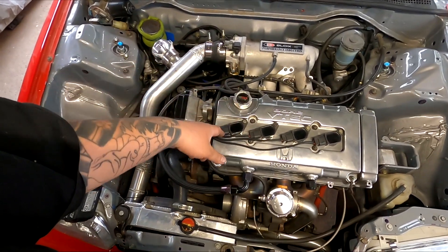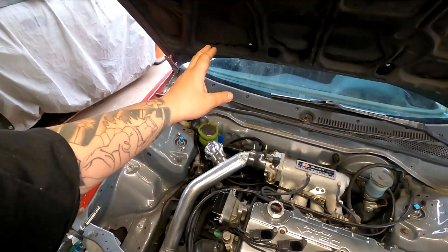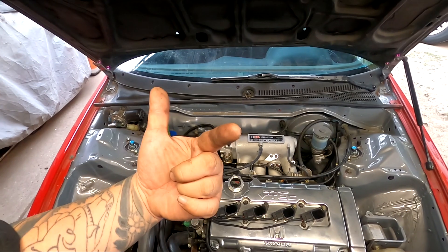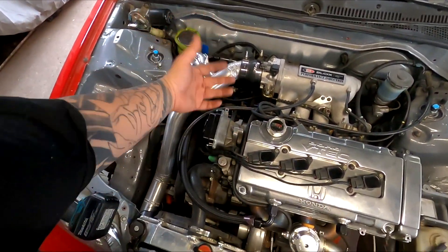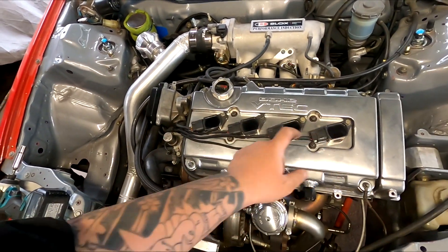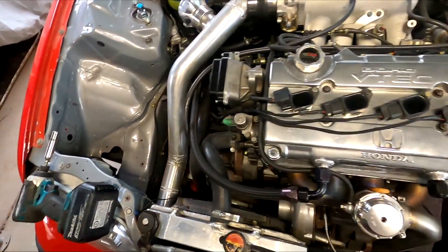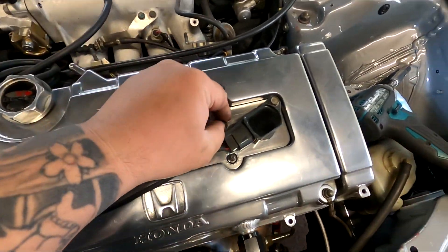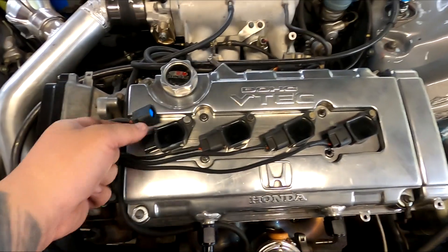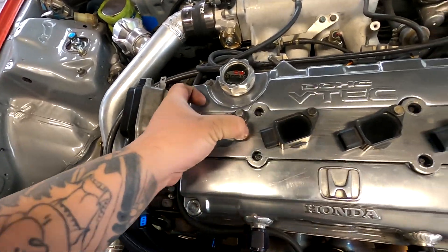The COP mini kit will solder into the board, and if you want to buy the kit from Nomus Industries, his link is always in the description below. You can get the kit which comes with coil packs — you can request spark plugs as well — plus the harness and the kit to solder into your ECU. If you don't solder yourself, you can send the ECU into Nomus Industries and he'll take care of it for you. I'm going to take off the whole plate with the coils on there since we're not using those anymore, but I'll still use the plug. I need to take off these nuts first — one, two, three, four — pop this up a little bit and the whole thing comes off as one piece.